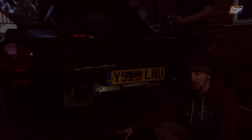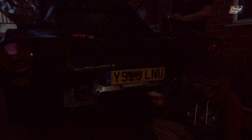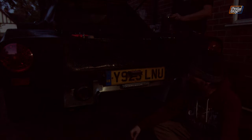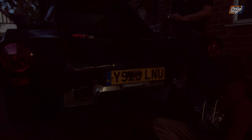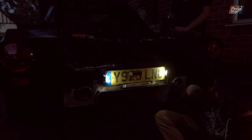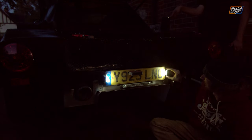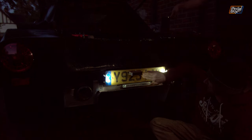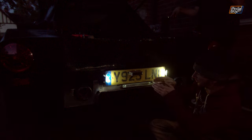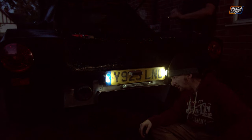This is a fairly dark shot, but there's a good point — we're testing all our bulbs and when better to do that than twilight. Everything is plumbed in, everything's mounted, all the brackets are welded on. Testing the number plate lights first — it looks great at the edges, but there's not really a lot of light getting to the middle. We might put them on little spacers so more of their light reaches the centre, since it's quite a shallow angle. It could be these are designed to go above or below the plate, throwing a wide but not very tall beam.